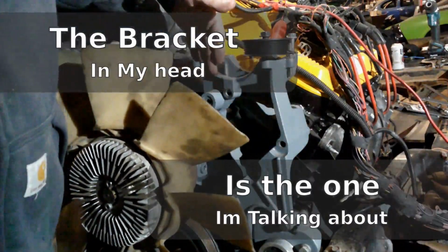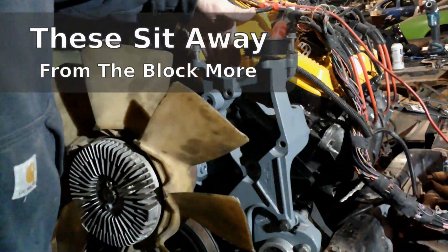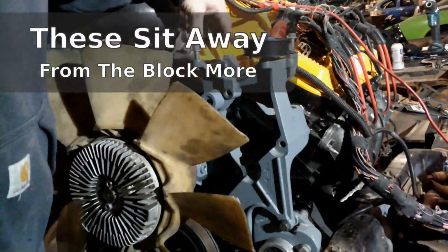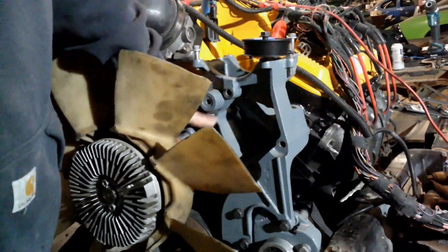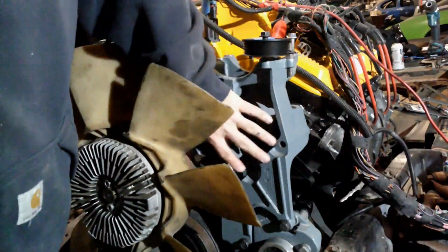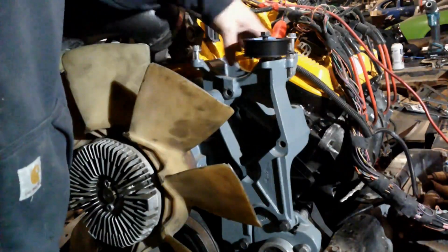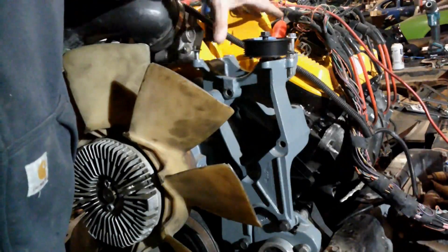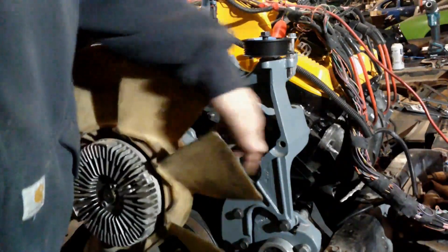What I have is for the big trucks like the Kodiaks and the box trucks, say brown ones or white trucks. So what I'm gonna do is figure out all the bolt pattern between the head and the block. We're gonna emulate that, and then we're gonna also make a plate or plate system for the AC compressor, which I still want to be able to use. And then